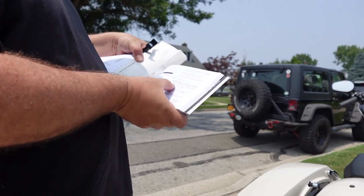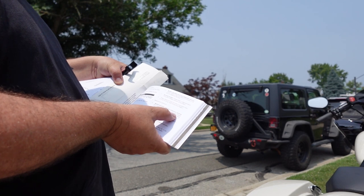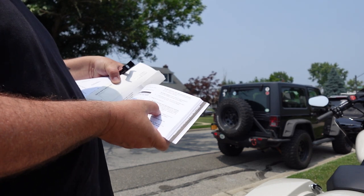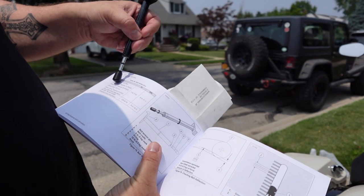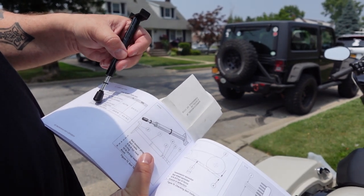All right, so it says, models equipped with belt deflection window. Measure the belt deflection as viewed through the belt deflection viewing window while holding the gauge steady. Each deflection graduation is approximately 1/16 of an inch. So that means those lines on the belt deflector equal 1/16. I don't have a Road King, I don't have a Street Glide, I don't have a Street Glide Special. All other touring models, standard shock absorbers,